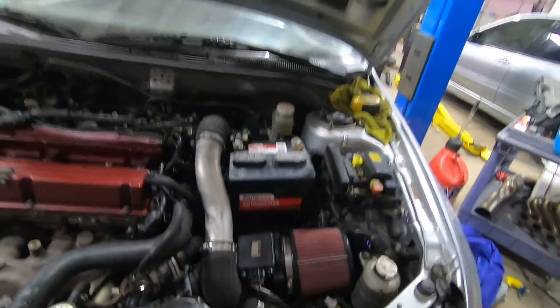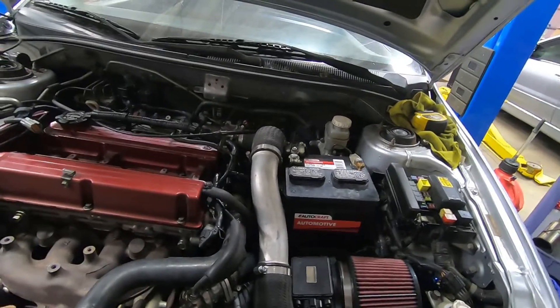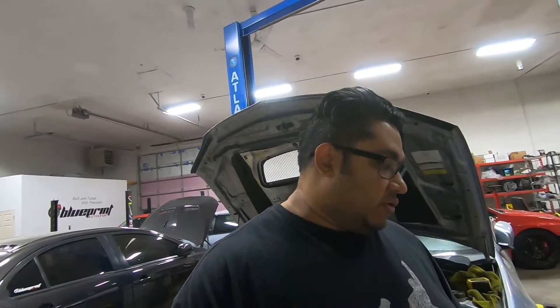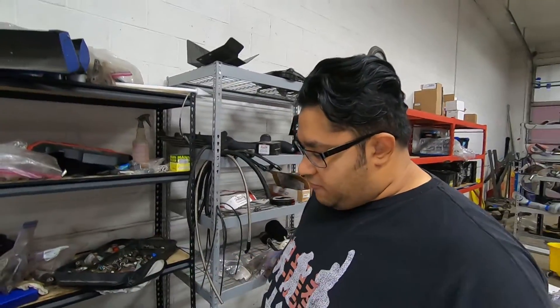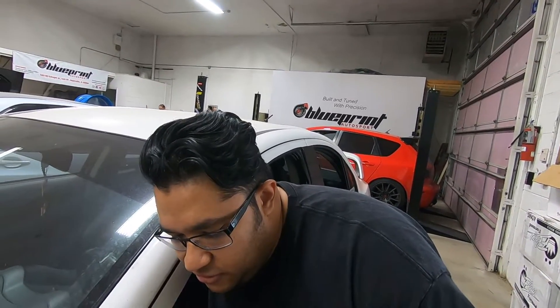On Evo 8s and 9s I personally like speed density. Evo 10s actually have a hybrid system — they use both a MAF and a MAP. There is a way to kind of trick the ECU into using a pseudo speed density. There's no tune out there right now that completely deletes the MAF calculations, so what you end up doing is setting all the values for the MAF sensor very high, so the ECU thinks something's wrong with the MAF sensor and stops using it, going only with the MAP.